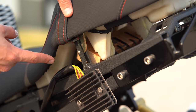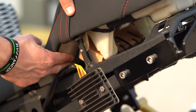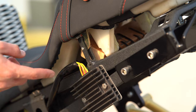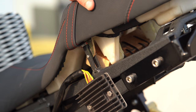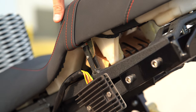This is my poor attempt at the Mike Jensen mod — I have to fix this. Essentially there should be a piece of wood that's long enough to touch the bottom of your seat and act like a bracket, so when you're jumping around the seat is supported and you won't crack it. I'm also running screws through the subframe, through the seat bracket, with a nut on the other side to keep the seat latched in. It's locked in here and locked in on the seat latch in the back so it isn't going to fly off anywhere.